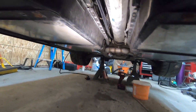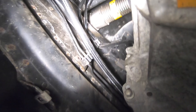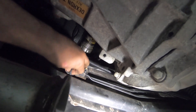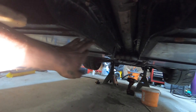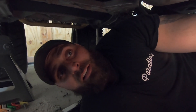Right now I'm running this line to where I want it to go. I have these half-inch hose clamp circle things — there are bolts right there holding the brake lines. These actually fit around here perfectly, and I'll take the bolt out and bolt it right to that. This way it's on here, it's not going to go anywhere, and it's away from heat. The biggest thing is I don't want these lines near any part of the exhaust. Having it tucked up under there and secured to the side of the trans tunnel is going to make it so much easier. I'll do a quick time lapse to get this done, and I think that's going to be it for today — we've still got to do the fuel rails and line everything up.